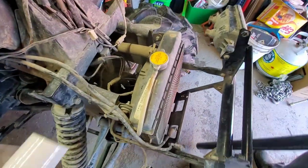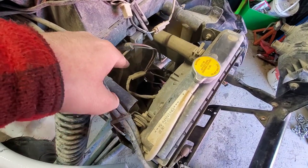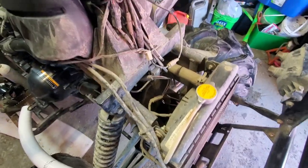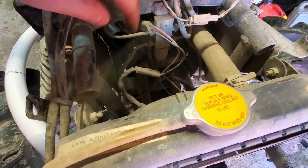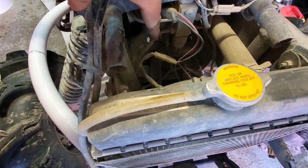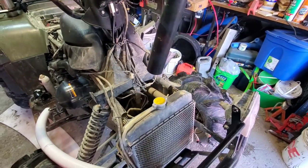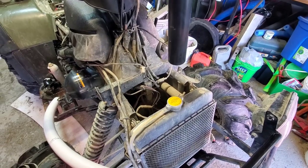And ideally we're going to come up and out right here. This rad is also going to be relocated up on top of the rack, so we're doing a rad relocate and snorkel install. We're going to come up here between the brake lines and the frame. With this material, we're going to heat it up, squish it down, fit it between. And it's going to come up in the center here somewhere just behind the speedometer using black ABS pipe. So that's what we're fixing to do — we'll find out if it's going to work or not.